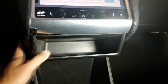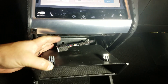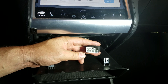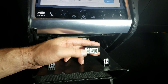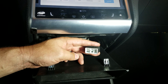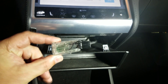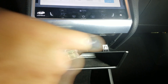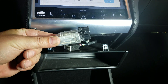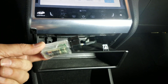The way you access it, you just pull this down — you don't need a lot of force. And you can see right away, here it is. It is not the right plug to plug in one of those Bluetooth adapters, so you need an adapter in between. I'm going to post a link where you can get those. I made a little adapter myself — I took one of those adapters and directly connected it to the Bluetooth adapter by soldering it and then putting it into a clear casing.